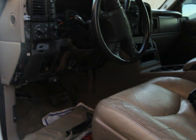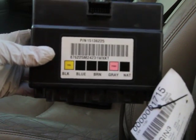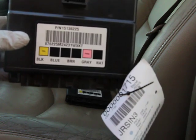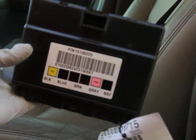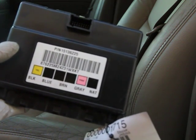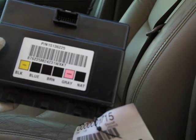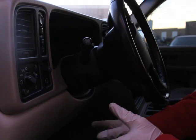Now that that's all done — under the very bottom shielding cover, there's a small metal cover under the steering column. You'll see the five wires going into the body control module; you'll have to unplug those wires, plus reach behind and pull the very top plug out. Here's the new body control module that I've programmed on the bench — this one is actually out of a '03 Tahoe. We have an '04 Suburban, but it has the correct pin assignment at the top. I've already removed the old one and I'm going to install this one, then cover the reprogramming procedure.